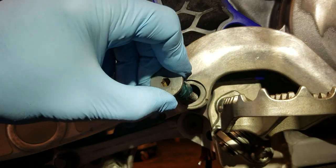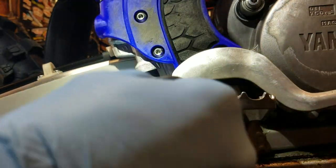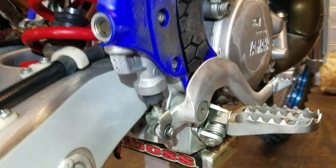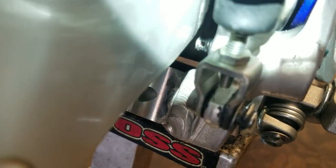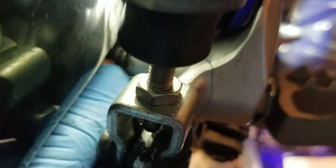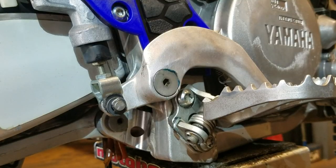Obviously, make sure you grease it up real good before you put it in, and make sure everything's nice and clean. You see how stripped out that is? It just slides right in. Before I put the bolt on, let me show you how much thread it has coming out the back — there's a lot to work with here, and it stays out of the way. I'll show you the stock one — this is my wife's bike and hers is not stripped out. You'll see it doesn't have nearly as much. She's got the clip on it, just enough to get the holes in the clip. I wanted more threads to make sure I get a good bite, and most of the bite would be before the holes — not after them — so that it's good and sturdy and doesn't snap.